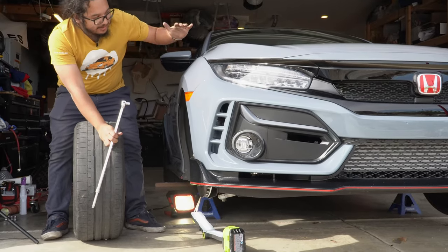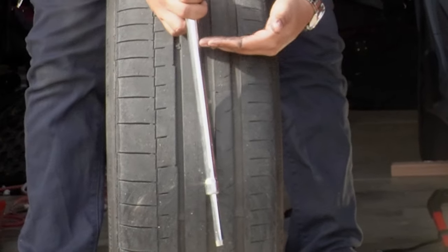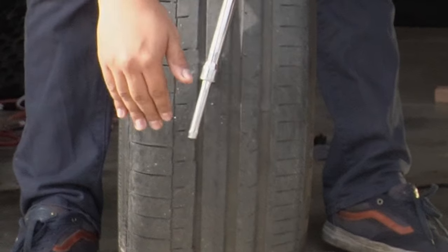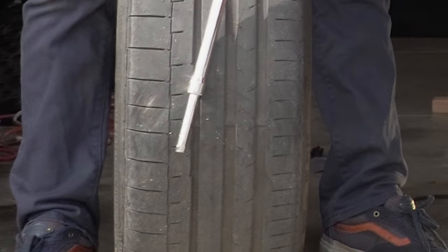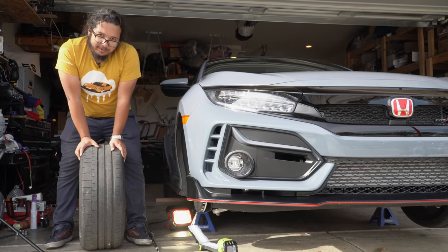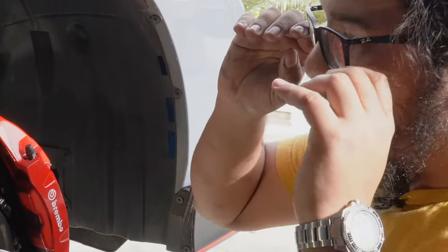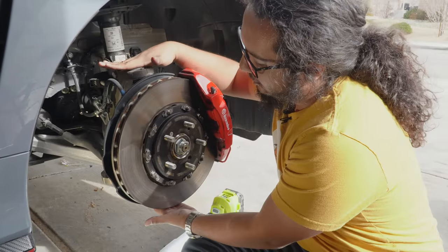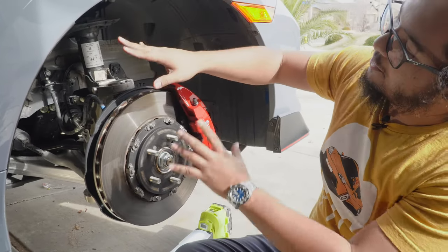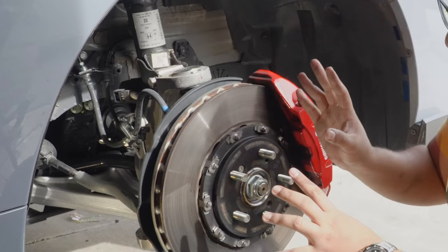What the Civic does is eliminate that top strut tower and bring it down with a ball joint, compacting everything into the wheel. You can position that lower ball joint exactly where you want. On a normal strut there's a distance between the center of the tire and the steering axis — that's called scrub radius. The less scrub radius you have, the better the steering feel, the better the response, the less torque steer, the better everything. Because of this design they could compact it all into an in-wheel assembly and dial in optimal steering geometry without having to mess with camber mounts or the body width.